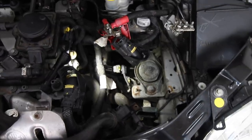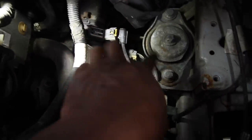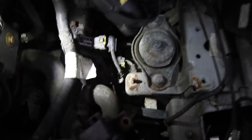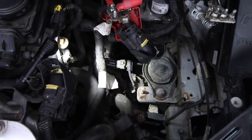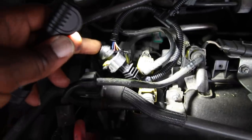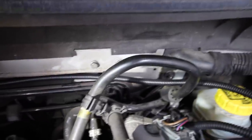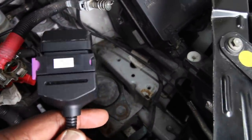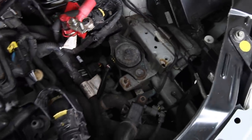We finally got the battery tray out, and that exposes our little connector here on the turbo downpipe - that's the reason why you need to get the battery tray out. You could attempt it with the battery tray in place but believe me, it's mission impossible. We disconnect that, plug our cable in, and then start putting everything back together. Our second connection is done, and I've run the pipework along a spare channel at the back to keep the cable trace nice and neat. That brings us back to the main box where we plug in the race chip.